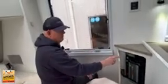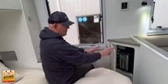This is your BM Pro operating system. It's your 12-volt operating system. Now it controls everything. This is like the computer or the module that runs everything. So it controls your solar, your batteries, your lights. All your lights are 12-volt. Water tank level sensors, all those types of things run through this unit.